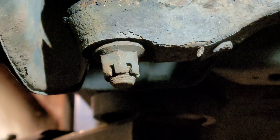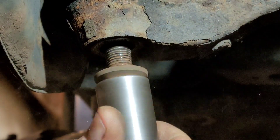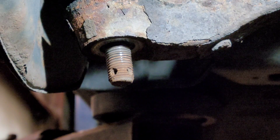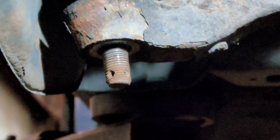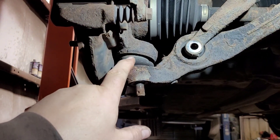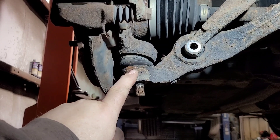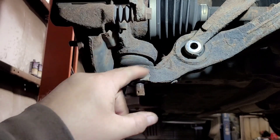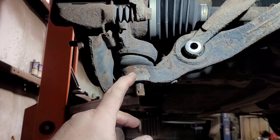So this should be 19. I'm actually surprised it's coming apart as nicely as it is, considering this thing does have some rust on it. So what's the next step? I gotta separate the ball joint now. Bigger picture: if you use a pickle fork in there to separate this, you're going to damage the boot — prefer not to. So a lot of times what you do is you've got to whale into this thing with a hammer, and the shock will help squeeze it slightly. It's got a taper into it, but the shock of hitting this with a hammer this way will squeeze it slightly and a lot of times it'll shoot this out.